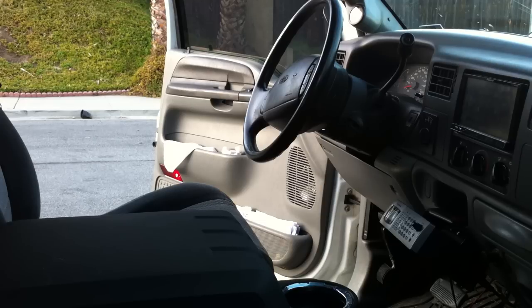For the rear doors, the speakers are not in the door — they're behind the rear seat if it's a crew cab, and I believe if it's a super cab, it's also in the C-pillar. Those are a little bit different; I believe you just need a Torx screwdriver to remove the seat belt and then the panel just pops off. I'm not positive because I haven't done mine yet — I'll have a second video on the rear speakers. But for most people, the front speakers are all they need because you can't hear the rear speakers from the front seat. If you're carrying people around all the time you might want to do the rear speakers. If you've got any questions or comments, go ahead and leave them down below and I'll answer them as soon as I can. Thanks.